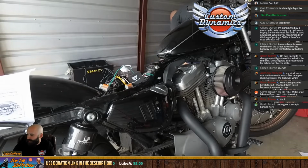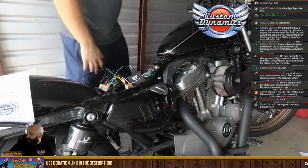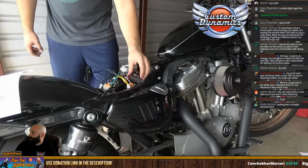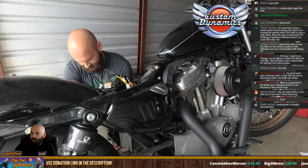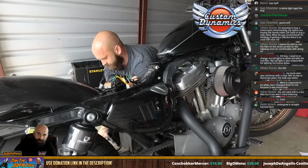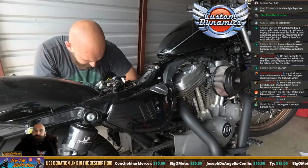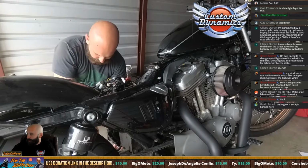They consider it. Yeah, some places underglow is just straight banned. So if you're stuck there, you're stuck there. And if that's the case, maybe look into getting better turn signals and rear tail lights. Custom Dynamics has that, and I think that's really cool. Especially their front turn signals, the Pro Beam and all that stuff, they're white until you hit your turn signal. So you get extra LED illumination up front. Then when you hit your turn signal, that specific one turns into a turn signal. So it has amber turning, and then it goes back to being a white light. I think that's really cool, and that works really good for Arizona because you have to have white or amber up front.